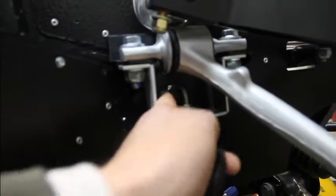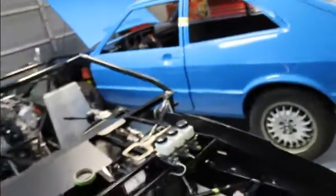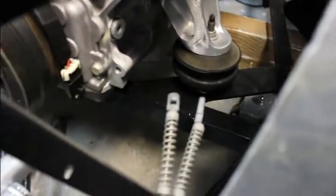I'll put that grommet in there. Worked out pretty good. Now I've got the rear brake in there, which dumps down, follows that back, and ends up coming out right here. I'll bring that back some more and probably get it right back down by that cross member, put a union in there, branch it over to the other side, and have it come out right there to get the brakes done. Then I'll get a hard line back there for the clutch and get that ready — not sure exactly where it's going to end up, but I'll get it bent right here and then back down in the tunnel.